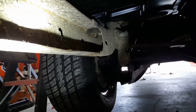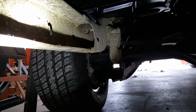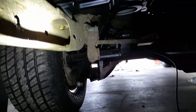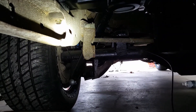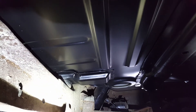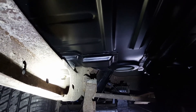As you can see here, I'm going to be doing the whole frame. I'm going to use a wire wheel on it, try to get most of the rust off. Then I'm going to prep it with the POR-15 prep and go ahead and use the Black Glossy POR-15 on it. I'll get a new panhard bar and the Hotchkiss stuff is going to be used on my car. I'm also going to use POR-15 on the trunk floors here that are brand new, and on the gas tank as well — probably the gray POR-15 for that.